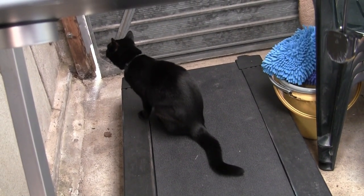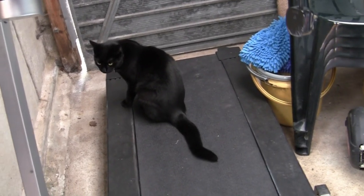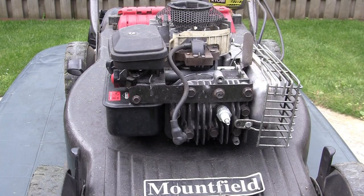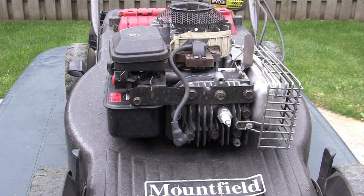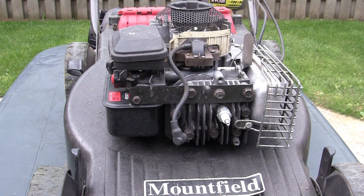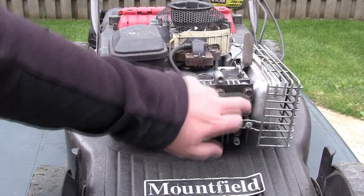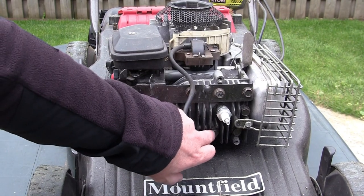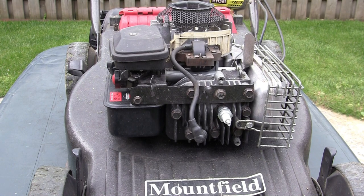Leave me a comment if you're enjoying the video, and if you've got specific questions, give me some context as to why — it leads to a much clearer answer. Now the last torque setting: the cylinder head bolts are 16 newton metres, for the bolts around the cylinder head. I get this question a lot. All these specs will be in the description of the video.